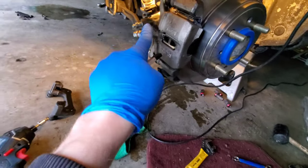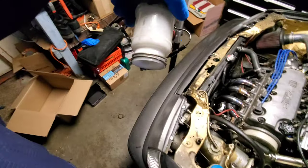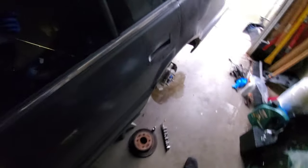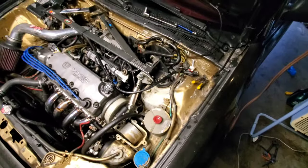Lines back on, e-brake back on, cotter pins in, and it's currently draining with a little free flow. I checked my master cylinder — opened it up and saw this black stuff. Looked in there and it's gnarly — a bunch of bad things. I have this other master cylinder I bought for about 55 bucks. I'm going to bench bleed that, throw it on there. Look at this — beautiful new shiny clear fluid, not brown with black clouds floating around in it.